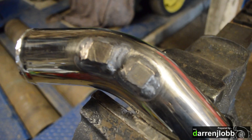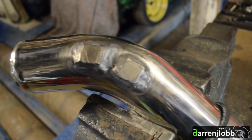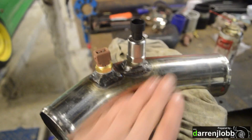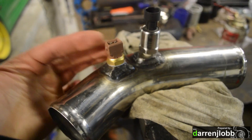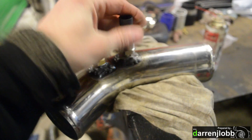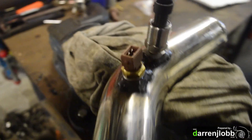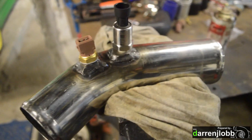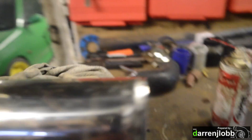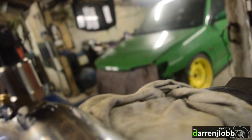I've just welded those two plates on there now, so we'll take it over to the pillar drill and bore the two holes. I've just tapped out those two holes on that intake pipe now — you can see we've got the air temperature sensor at the front and the MAP sensor at the back, which is the Tronix sensor, just to give us a bit more range rather than using a conventional stock MAP sensor which is only about 3 bar. That one will give us plenty of range — 75 psi on the 5-volt — so that should be good.